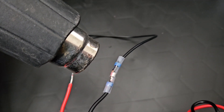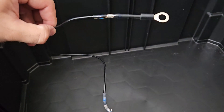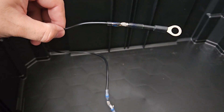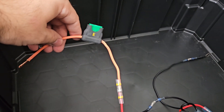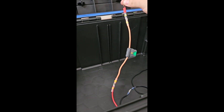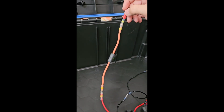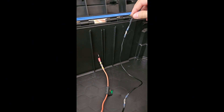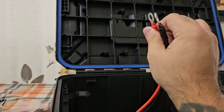This also acts as shrink wrap tape that melts down. Once everything is soldered, wrap it in black electrical tape for safety. For the positive wire, we're adding a 30-amp fuse for safety, solder it in, then wrap it in red electrical tape to identify it as positive, and wrap the negative in black tape.